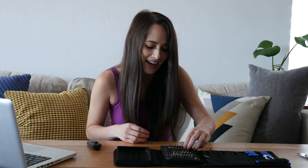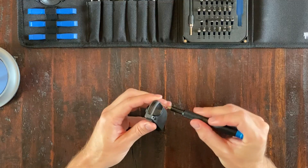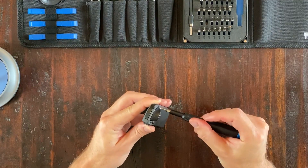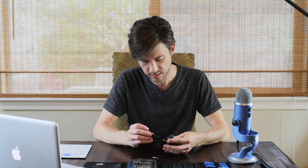One of the hardest parts about repair is actually just seeing what the bits are. You want the largest driver bit that will fit and fill the screw head. If you go too small, you can strip the screw. This actually feels a little loose — I may size up. Let's see how the Y0 feels. Yeah, I like that better.